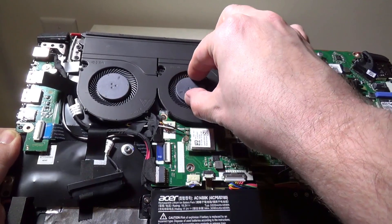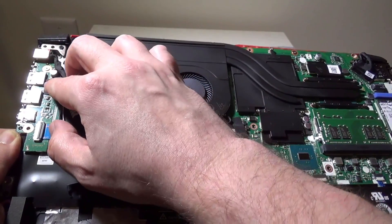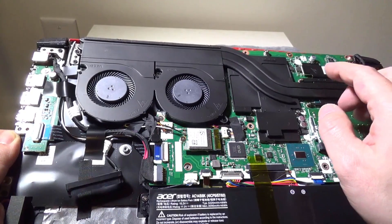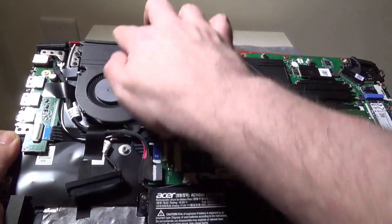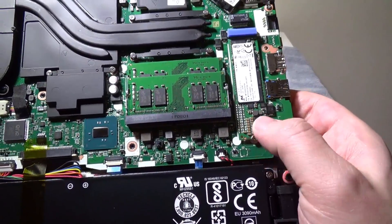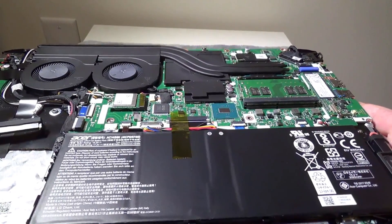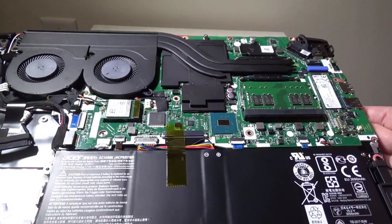Now you have complete access — just like with the VX15 — to pretty much everything: your battery, the fans, the M.2 drive, your wireless card below the fans. These are the new Aero Blade fans, supposedly made out of metal. The design has moved to dual fans on one side instead of one on each side. There are three heat pipes — two go from your GPU, then turn into three at your CPU, and get funneled into the fans and exhaust out the back. On the right hand side you have that Micron M.2 drive, and you can now replace it with an NVMe-enabled one — the slot supports it — but you do have to remove the bottom of the laptop to get there.